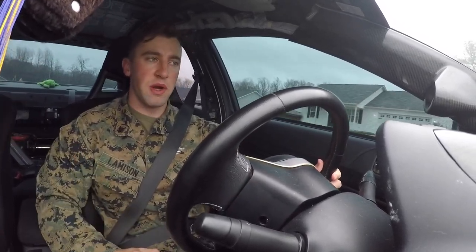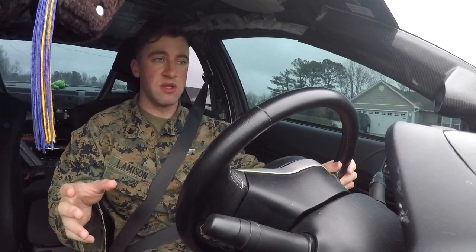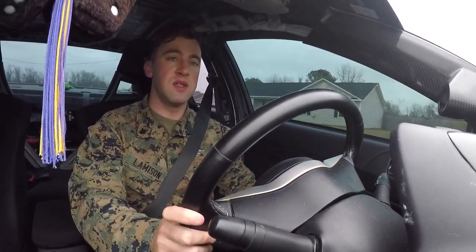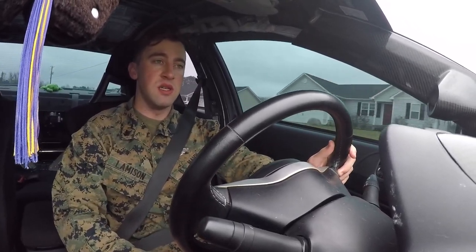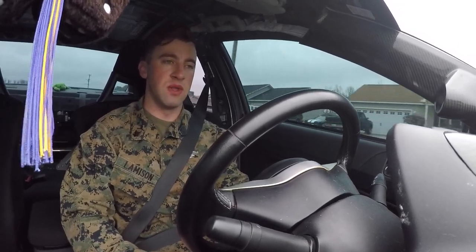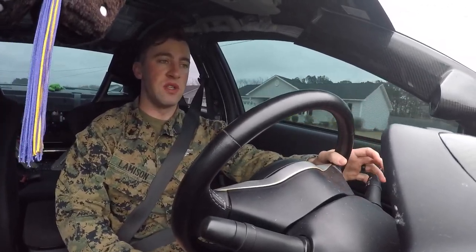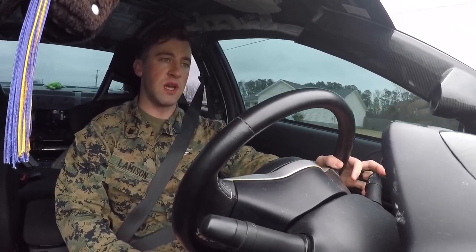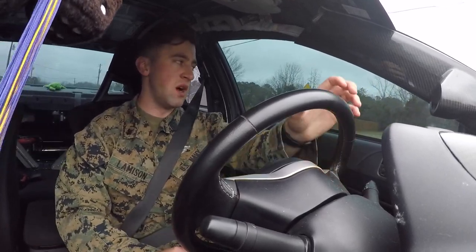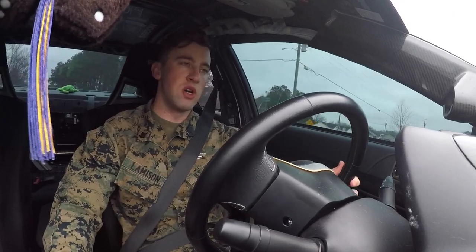My compressor from my bags cut me off during recording and then I accidentally deleted the second part, so here's a quick recap. I got an ACT HDSS clutch and an ACT streetlite flywheel put in. I had the shop do it because I've never attempted a clutch install myself. Now the car is super smooth and it resolved most of my issues. It's very touchy stop and go but that's just because it's a brand new clutch — I'm still breaking it in. I'm still under-boosting a little bit, getting up to about 13-14 psi instead of the 25-26 I'm used to. I'm not totally sure why, but the car is running smooth and fine for now.